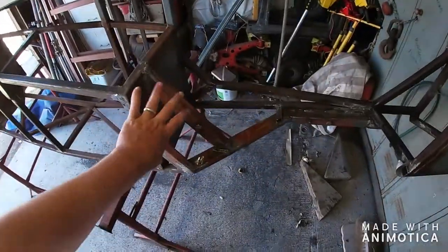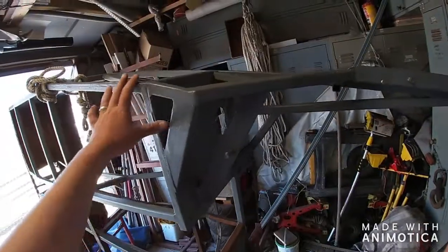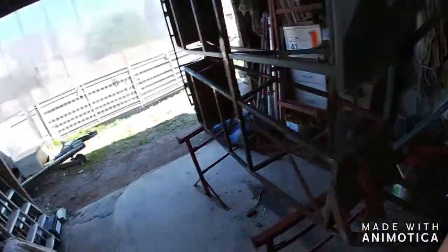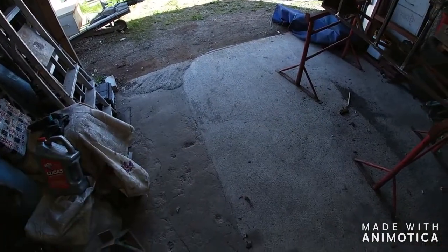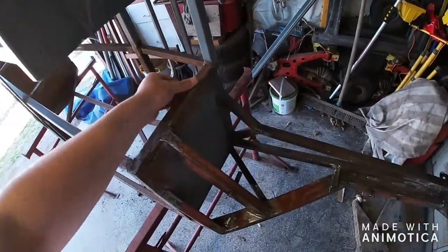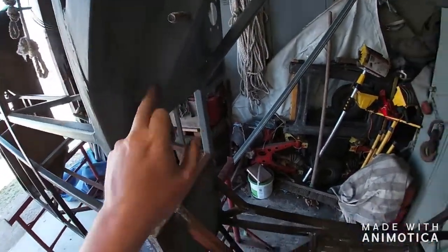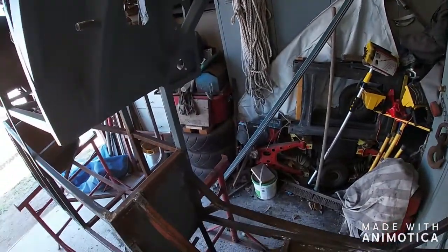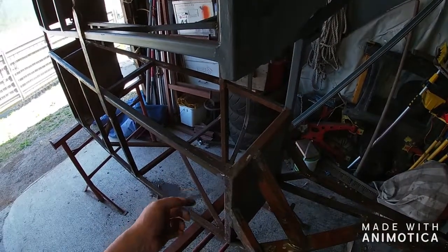As you can see, all this area is welded and sorted now. The plan for today is just to clean all this up, same as I've done with all this area. I've got the sanding disc - bought some more of these cheap ones that'll do the job. I think they're 60 grit. I'll get one of them on the grinder and clear all this surface rust off, and give everything here the same gray undercoat I've got on that bit.